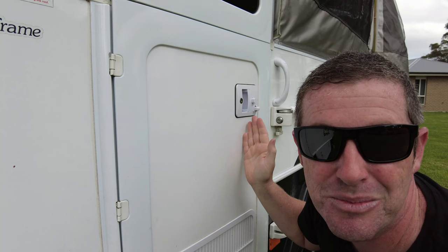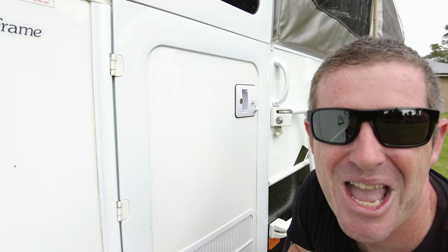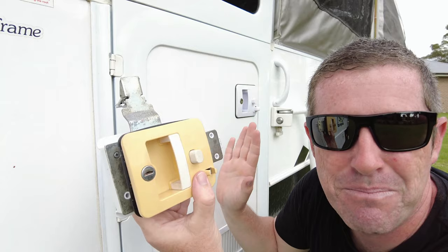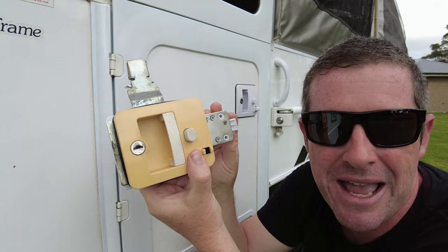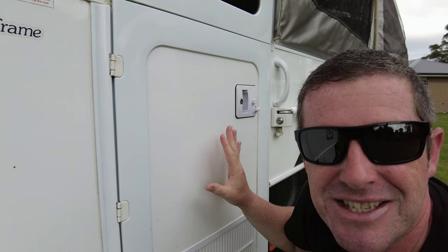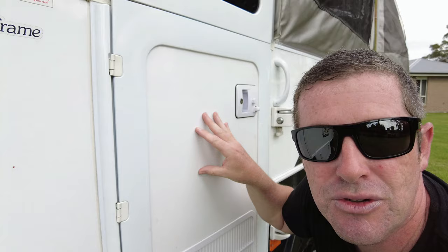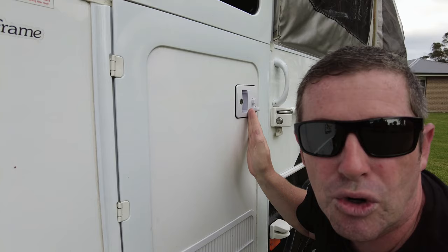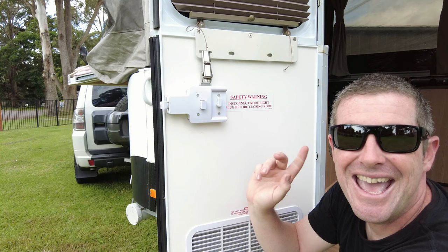When it comes to these door latch mechanisms, note you can buy brand new ones from Jayco or Coast to Coast themselves. We updated ours primarily because the plastic had gone all yellowed, and I went through and changed all our grab handles, vents, and bits and pieces when we first bought the van, just to make it all nice and fresh — and that also meant the mechanism worked a little bit better. One important thing to note is that there are two different latch mechanisms. When these smooth wall vans came in around 2007, this new door style was introduced: there's a black door latch mechanism that runs up to about 2012, and from 2013 onwards we have the white style one. So if you're looking to order a new door latch mechanism, take note of what age your particular camper trailer is, as they vary between generations.